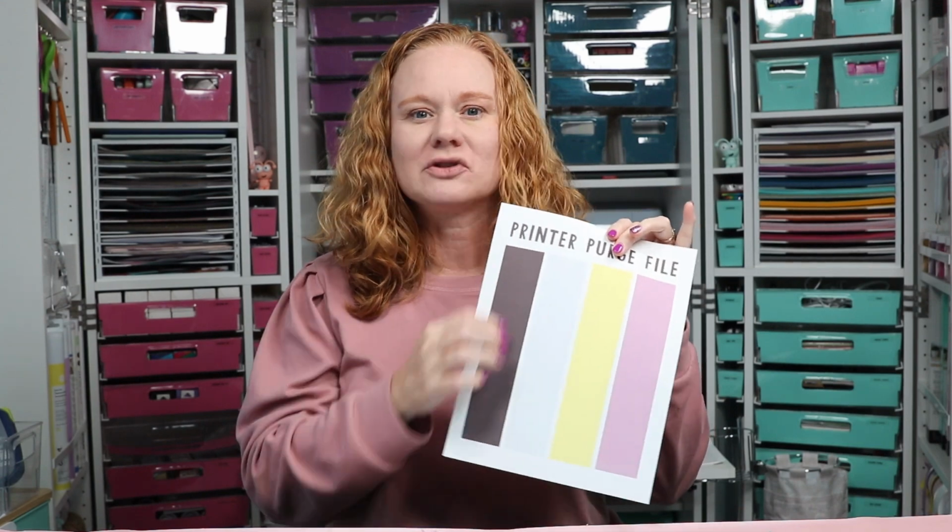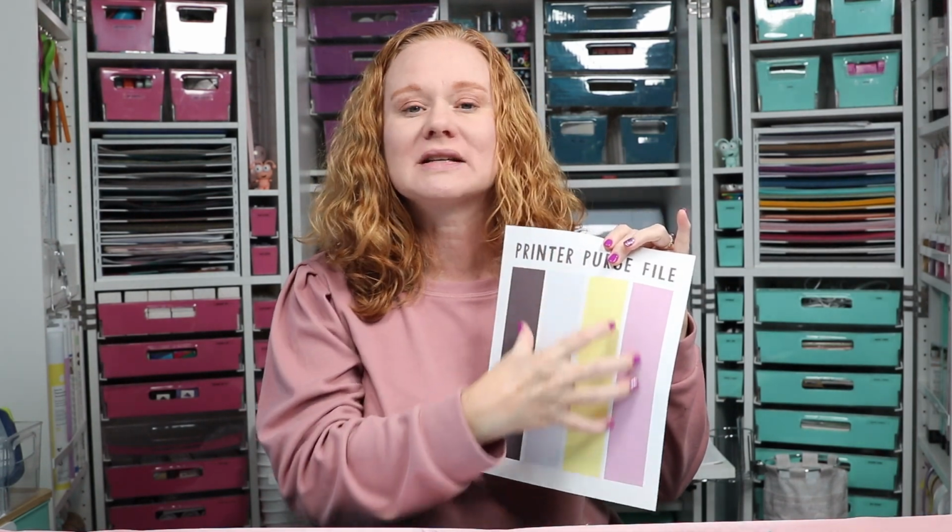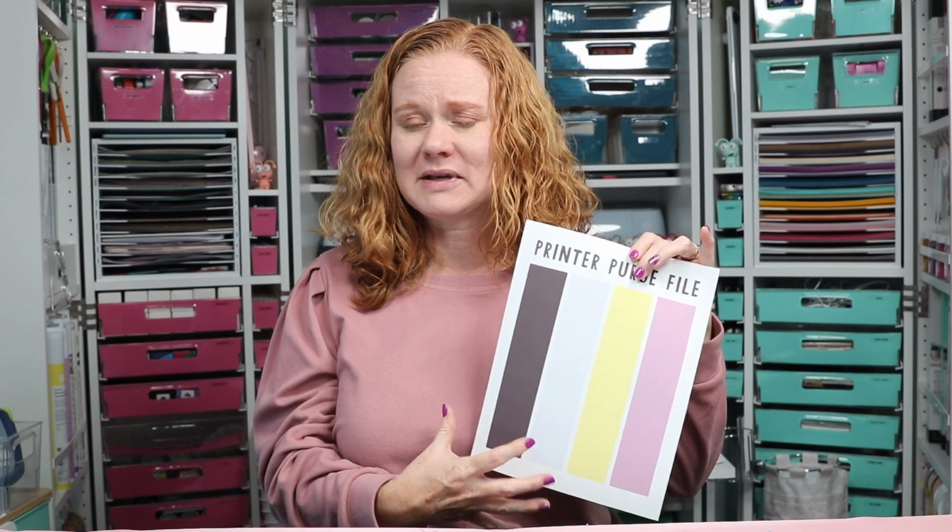Then what do you do if these don't work? So if you're printing printer purge files and you're still getting lines, you're still having issues, maybe one of the colors is completely missing, two of the colors are completely missing, you probably have a more extensive clog that will require you to go a few steps further. And I do have another video on that, and I will link to that video in the description below this one. You can head there if you have an Epson EcoTank printer and learn how to clear those clogs. Other types of printers, I don't personally have a video on those, but you can probably find one out there on YouTube. So go to more extensive clog clearing videos if your printer purge file just doesn't work.